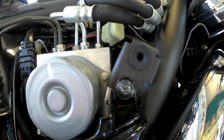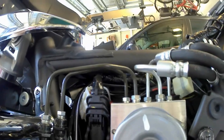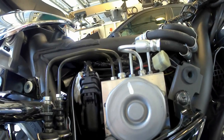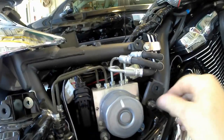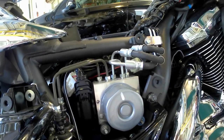The biggest pain — one side came right off because it's a bolt, but on this side they used a screw that was almost like welded in place. I tried different types of impacts, even a hammer impact, and it wouldn't move. The good news is I don't have to worry about that right now unless I'm messing with the ABS system. I was able to pull it out just enough to reach up and get the oxygen sensor plug. I'll probably touch up some bare metal so I don't get any rust showing up.